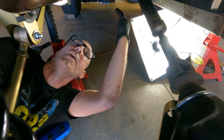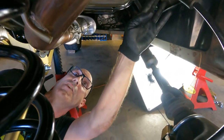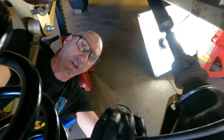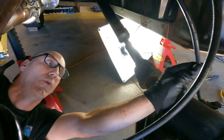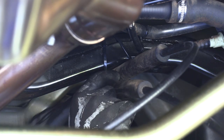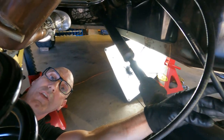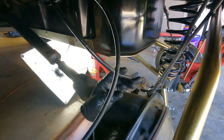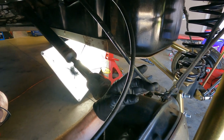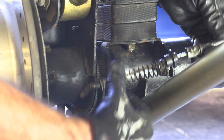Now that you have your parking brake cables loose and ready to go, you just run that back over the crossmember up here and attach it with zip ties. Like I did on this side — the driver's side is still attached. Over here you just get your zip ties happy, dial it in, route this over the axle, and go over to the other side and reattach that. Simple as that, and that's how you get max droop.